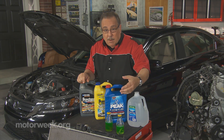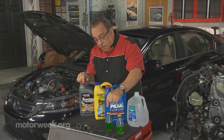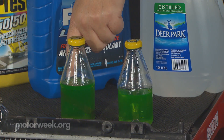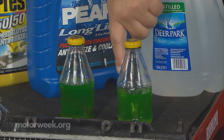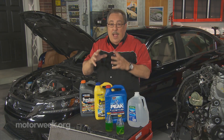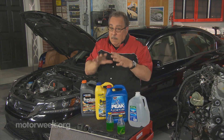Namely, you don't put any water in it — you just put pure antifreeze in your radiator. Well, here we have pure antifreeze with a bolt in it, and the bolt is all rusty. But look what happens over here: we mixed it 50/50 with distilled water and the bolt is still shiny and bright. You have to have the water mixed with the antifreeze, or coolant, to make it work properly.